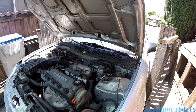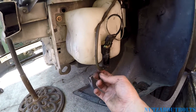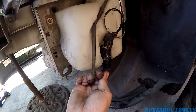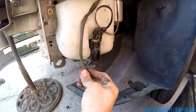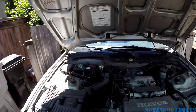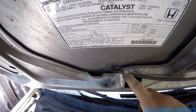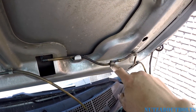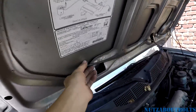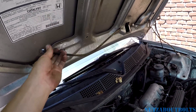I'm gonna give it a good cleaning and put it back together. Before I button this up, I want to make sure everything works properly, so I'm gonna pull this hose back off and blow the line out clear to get any crap that's in there. Going up top, this little connection to my plug nozzle is being difficult, so it was easier just to disconnect it at the Y. Then squeeze the tabs and push it up through the hood.